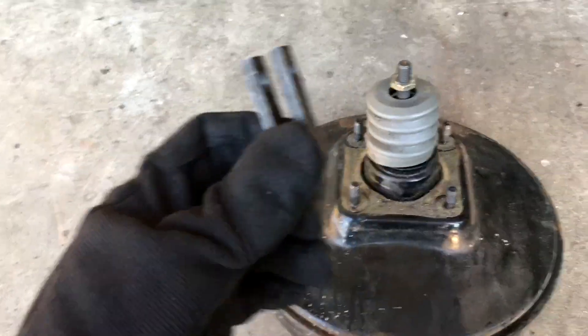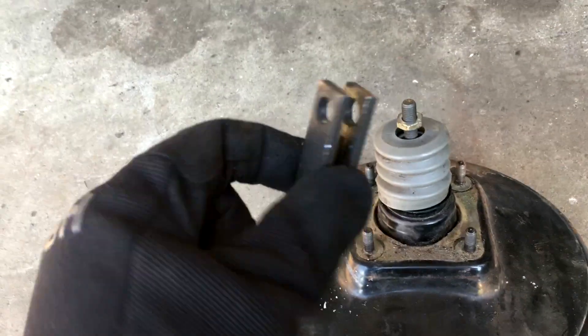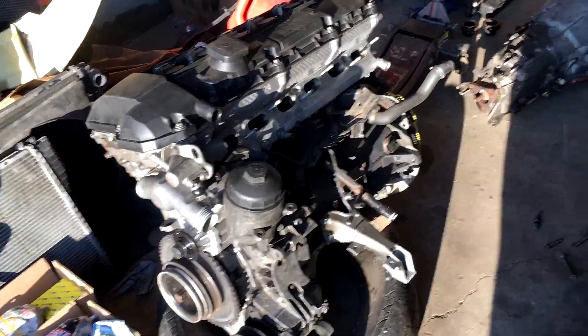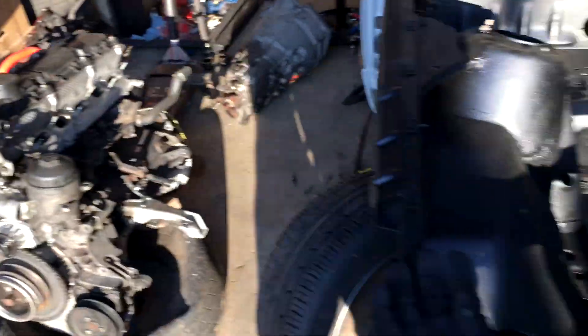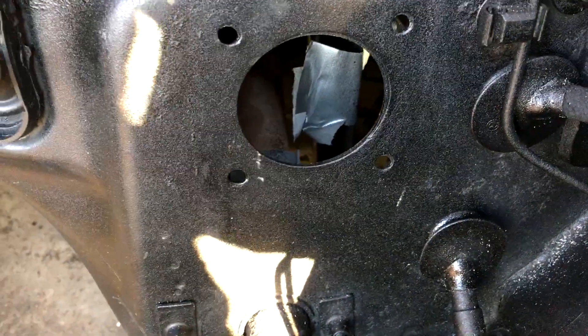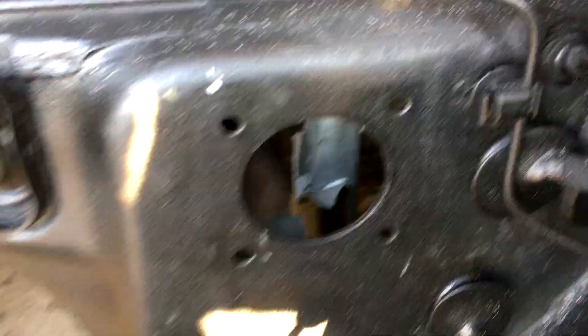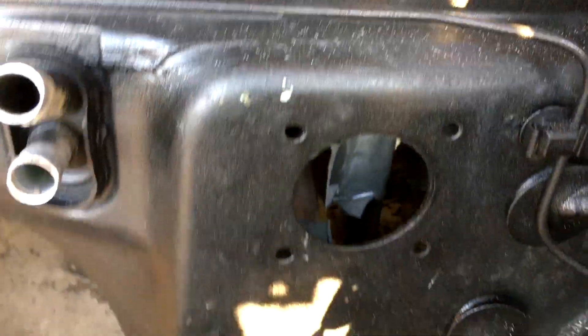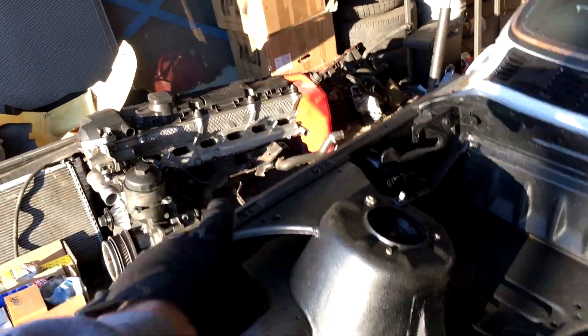In this video, I'm gonna be making the modifications to the brake booster and the little clevis here out of my E30 so that it could fit the M52, S52, S50 and all those. What I'm gonna be doing is I'm gonna just be re-drilling them. I read a forum post that said all you have to do is drill them 0.5 inches — half an inch — to the right towards the driver's side so that it could clear the intake manifold on the M52.